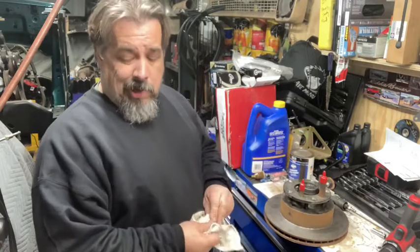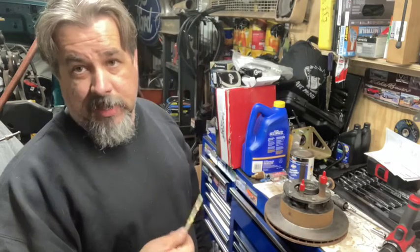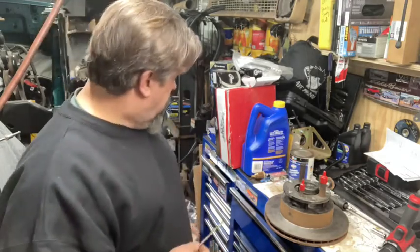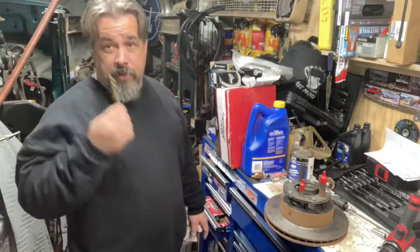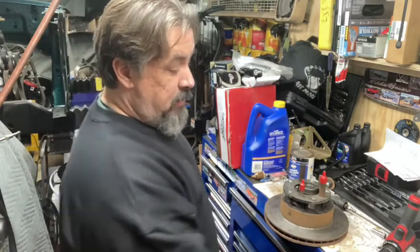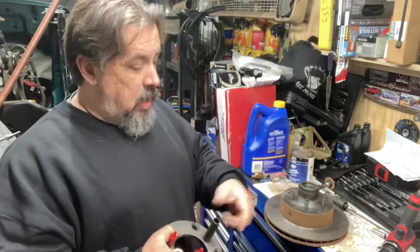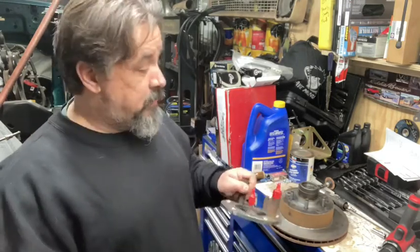It's a little time consuming. Fresh drill bits make the world of difference. I just bought some cheap ones — I lost the bits that came with this kit since I've had it for five years and switched toolboxes. Since I kind of remembered the size, it wasn't a big deal. I just went down to Harbor Freight and got a box of quarter inch and used a new one each time I did the rotor. The trick is when you're drilling it, pull it up, drill it, pull it up, drill it — that way it'll bring the shavings up out of there. Each time you drill, drill a second, pull it up — you'll see the shavings come out. I did not put any oil on the quarter inch bit, but I did put oil on my big bit because I only have one of them.